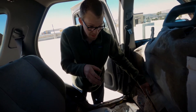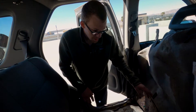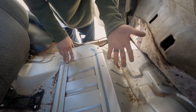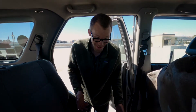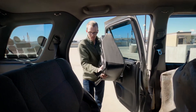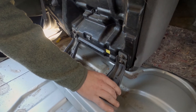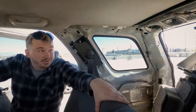With the carpet up now, we're trying to find the best route to line that wire so it is out of the way and doesn't get pinched or stepped on. It looks like it'll just come across there and hug the inside of this hump and down here. I'm gonna tape it down and clean the surface first so the tape will adhere — it's got 220,000 miles and 20 years on it. The hinges might be in the way, but double checking with the seat, it is completely clear. The seat bolts in here and folds forward, so that wire is gonna be way out of the way. The hardest part is gonna be opening up that harness and undoing all the tape, and then re-taping it because you don't want those wires all flopping around.